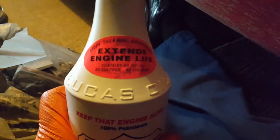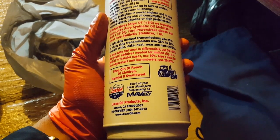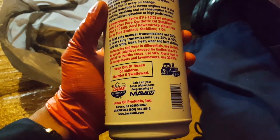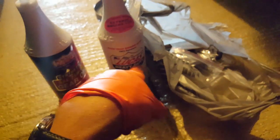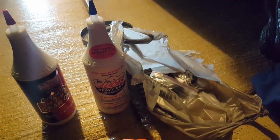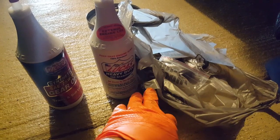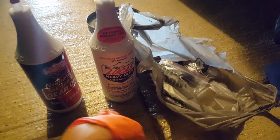You'll notice this contains no Teflon, no sulfur, no chlorine. This is the heavy-duty oil stabilizer. It says when putting this in a transmission to do 25% to 50% for light-duty manual transmissions. So according to Lucas, when you mix this and this half and half, you're going to have a sulfur content that is acceptable for GL4 quality. It's basically going to dilute the strength of the GL5 while keeping the lubricity, keeping the weight, temperature control, and the smooth shifting — let us hope.